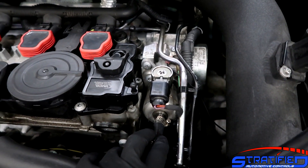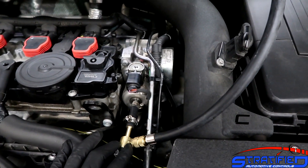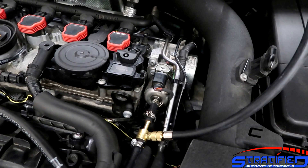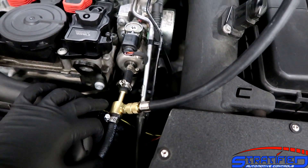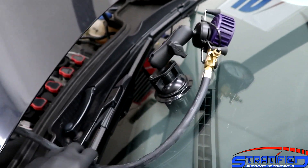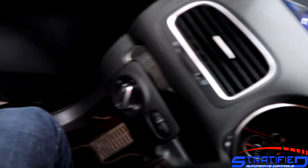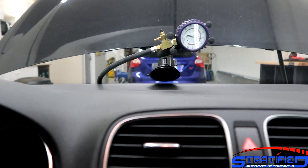Once you've identified the low pressure feed — which in this case is right here — you want to get a testing kit. These kits you can find on Amazon anywhere from $30 to $100 depending on accessories. The kits usually come with a T-connector — you can see this T-connector right here — and then the gauge itself screws in right there. All you do is disconnect the OEM line, put the T in, put clamps so you don't have any leaks, then run the line up to the gauge. Because you want to observe this while you're driving, we use a suction cup mount facing the driver, and you can start the car and see the gauge reading while you're driving.